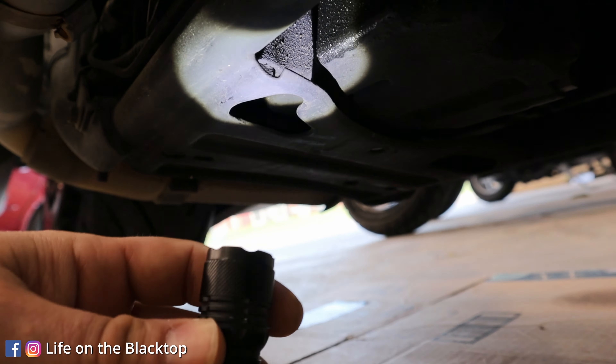Also, there's an O-ring on there — we're going to pull that off and change it out. I believe it's a 012-sized O-ring; if I'm wrong, I'll put it at the bottom of the screen. I always clean up where the O-ring seats on the bolt itself, that way you know you have a good seal when you go back together. Put your new O-ring on — it just slips on there like that. Then you want to torque the drain plug to 14 to 21 foot-pounds. It is O-ringed, so it doesn't have to be extremely tight — 14 foot-pounds is not a lot.